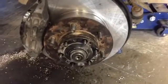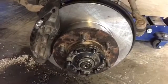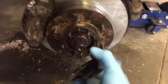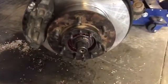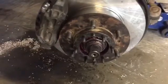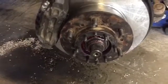Another important note: whenever you're checking the bearing preload on your Toyota T100 or 4Runner of around the 1993 model year, you do not want this flange attached. This flange connects the hub to the CV axle, and the CV axle takes a considerable amount of force to turn over. If you were to take the CV axle out of the car and attempt to turn it by hand, it does take considerable force to articulate the constant velocity joints.